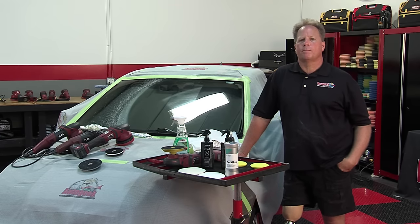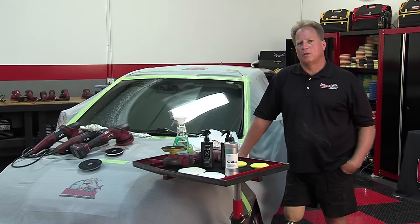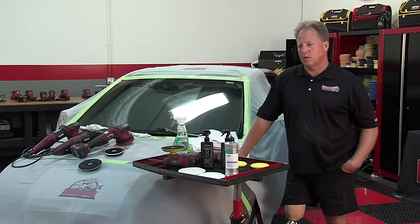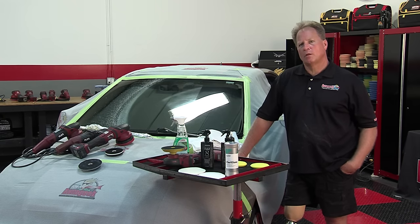Okay, the question that we asked earlier about the BMW. Vehicle-friendly, eco-friendly, clear-coated, extremely soft. He used the Optimum black pad with Hyper Polish. The D3 doesn't know anything else but the Optimum system. Optimum makes good stuff, but you might have to step outside that line and grab something. Menzerna makes products that are foolproof for soft paint. Enster, that's the guy's name. So I'm talking to you directly. Hold on, let me bring you up so that you're not a voice from the nether. Was the black pad the microfiber pad or was it a foam pad? That's the only thing that I'm not clear on. Post that in there and then I'll get back with you.